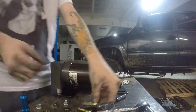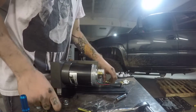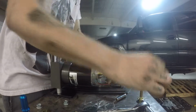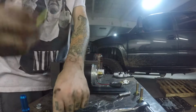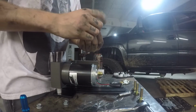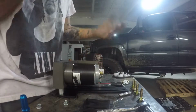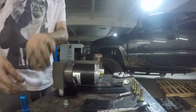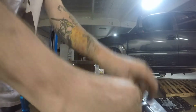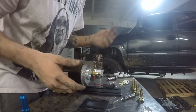All right, guys. So these bolts here that they give you, we're gonna go ahead and add the washers. Make sure the washers are on the side. Need 4 of them. I think I should actually see what size this is first before I put these on. But this rubber, make sure you put this rubber on the backside, like I said, guys, otherwise you're going to hear a bunch of rattling around, and metal to metal contact is not good. So just make sure you use everything. If you got anything left over, you know you're not doing it right. It's the best way I can say it.